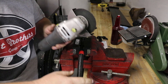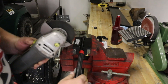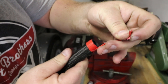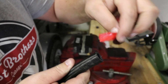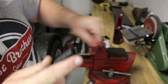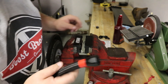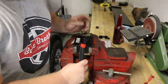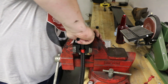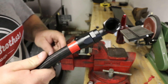I'm cutting this hose with a cutoff wheel, which probably isn't necessary on the nylon hose but it makes quick work of it. Having the tape on the ends leaves a really nice edge with no frays — very important. One other important step: make sure that you flush all of these hoses out before you assemble them on the car for the final time. More lube, rammer home. That hose is done. We'll install this and the oil cooler will be finished.